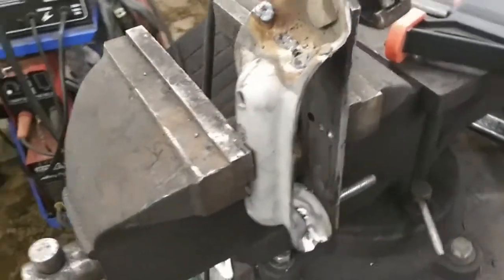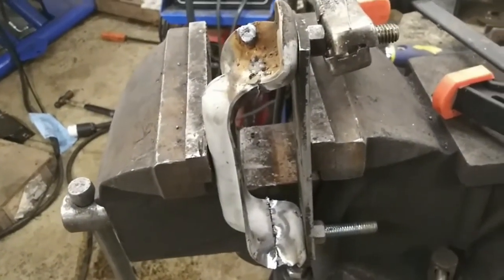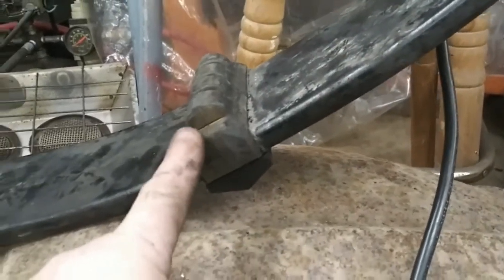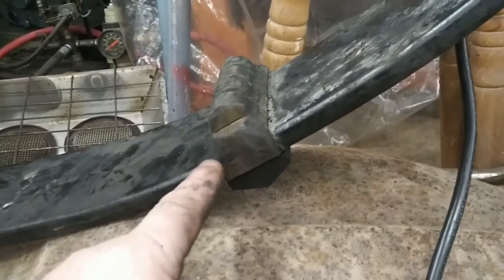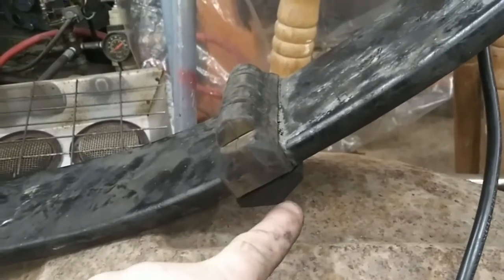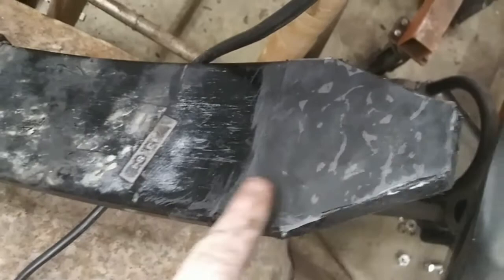They're not super complicated. You just have to figure out, measure the distance, because the bracket slides over this to the tip of the wedge, but you have to consider that this is rubber, and when you clamp it down it's going to crush a little bit, and so that's what I did. If you have the equipment to do this at home, welding and whatnot, you can weld your own, or you can just buy the other ones. I leave that up to you.